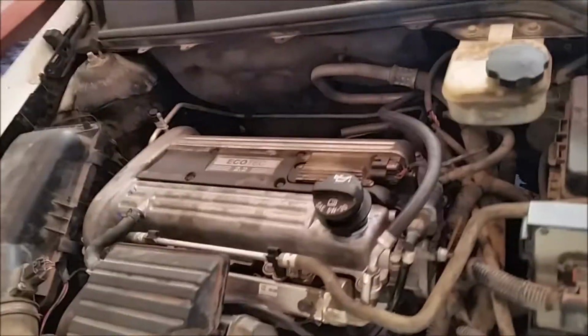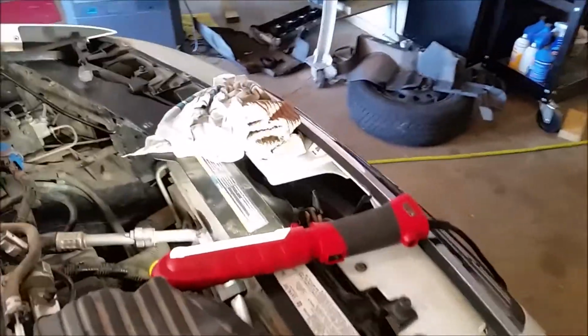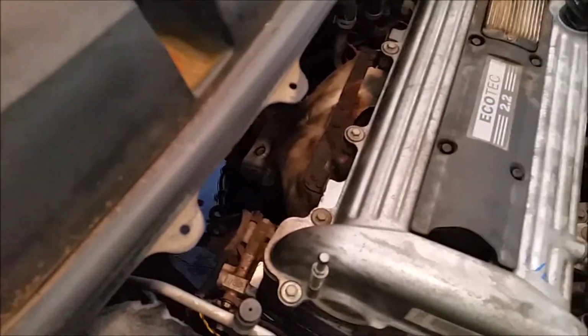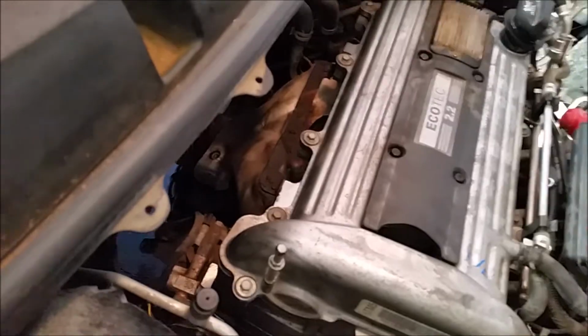Folks, we're just about ready to go. We've put the air box on. Of course, the head is on. That was earlier. And we got new spark plugs. We got fresh oil. We got fresh oil filter. Right down there is the oil filter. And blew out the air box and the filter. We've got the heat shield on the back there. It's not bolted in, it's just set in there. Can't find the bolts right now, but we will.